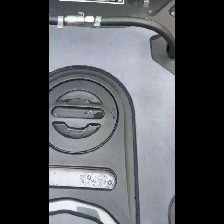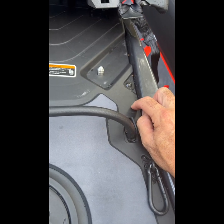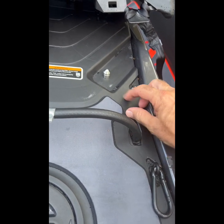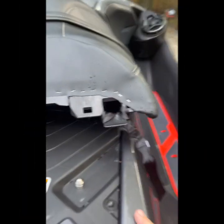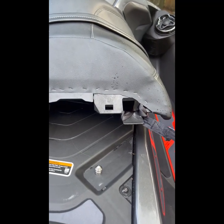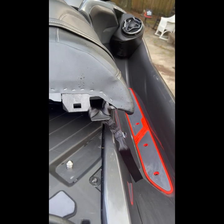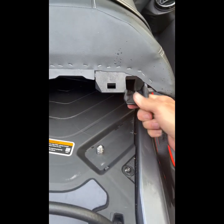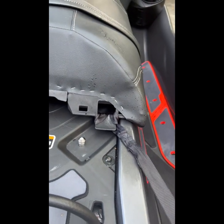In my first ski, I actually drilled a hole right about here. I took a grommet and put a grommet on top and epoxy glued it down, and it looked pretty nice — you couldn't tell that it was cut out or anything like that. That's the second option. Third option: you could take a motorcycle strap and put it on your seat, lock your seat in place. This little square doesn't hurt anything, doesn't mess with anything. You put it in right here, and I'll show you a finished product — the strap is in place and it is not going anywhere.